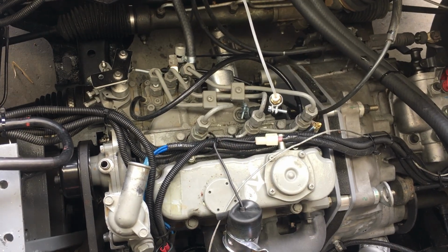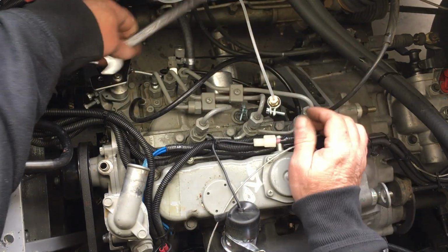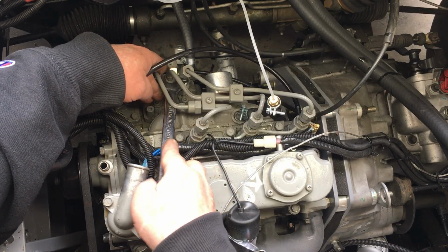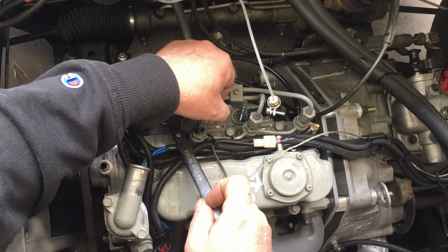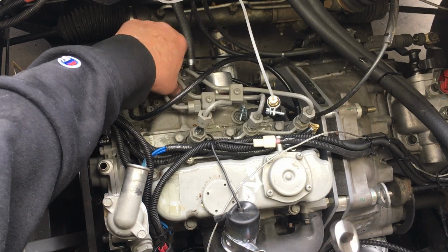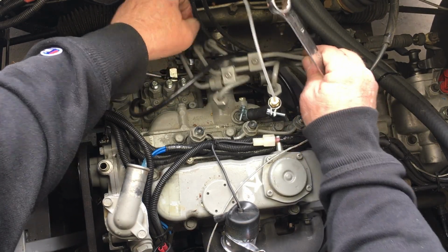we did. If you go back and rewatch the previous episode, we managed to set a new record time, and we did the 0 to 60 in 31.97 seconds, but we also did it without triggering the exhaust gas temperature alarm. Now, to be fair, the alarm did go off a few moments after we hit 60 miles per hour, but that was edited out. Typically, the alarm comes on well before we hit 60. Anyway, that's why I increased the boost without giving the engine more fuel.